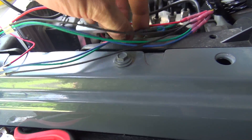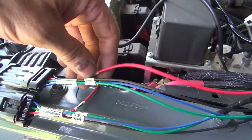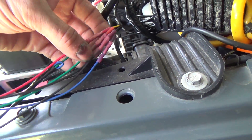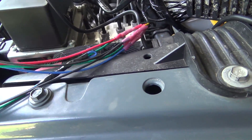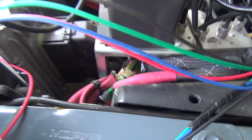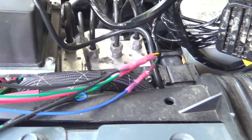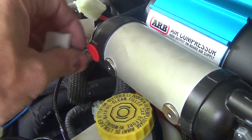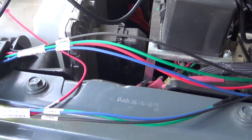The red wire is being fed by turning on switch one on the first block. The output of that powers the red and also acts as an input red to the two other switches. Then yellow — switch one, my green, feeds switch one on ARB which is yellow. And then switch two here is blue. They're kind of labeled upside down, but switch two is the blue one on this, and that's going to feed the green ARB circuit which is locker number two. Then I've got to hook up my solenoids and get my pressure switch in here, and then I'm good to go.